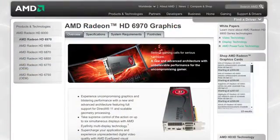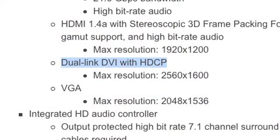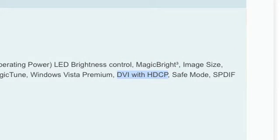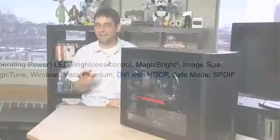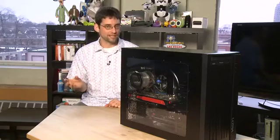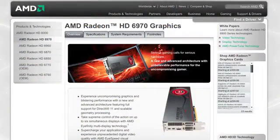You may need a couple of extra things to make sure you can play back Blu-ray movies. One is a video card capable of HDCP encoded content — check the card you have and make sure it is capable. You also want to be sure your monitor is capable of HDCP content playback. If these two components don't support HDCP and you try to play back a Blu-ray movie, nothing will happen. So while you're inside the case, you may want to upgrade your video card too.